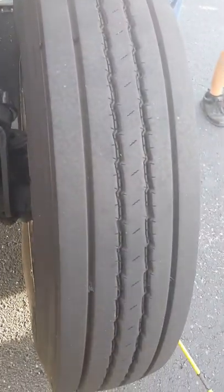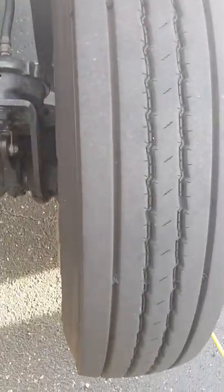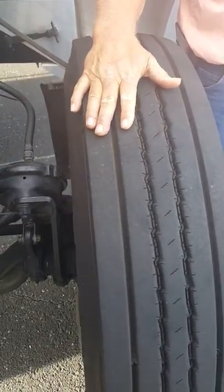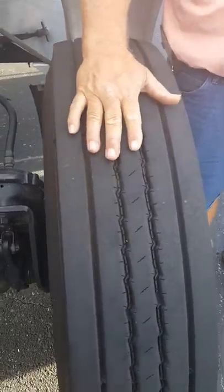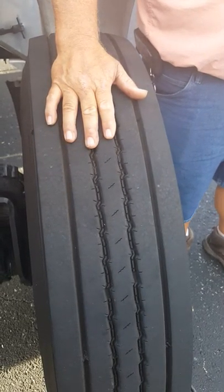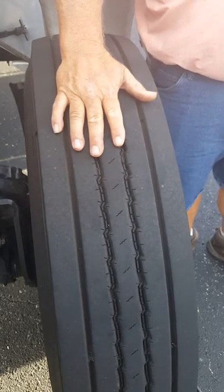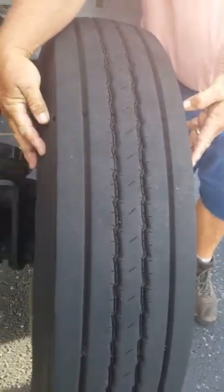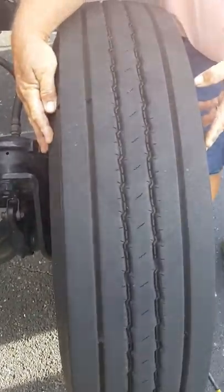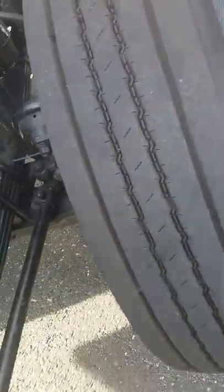That is my braking system. Now moving to my tire — I'm looking at the face of my tire for even tread wear across the face. It's not wearing off just one side. I'm looking for at least 4/32nds tread on the front tire — it will be 2/32nds from here on back. I'm also looking at the inner and outer sidewalls for any cuts, bumps, bruises, blemishes, or sidewall defects, and it appears to be free of all of those. Looking at my valve stem — it appears to be straight and does have a safety cap.